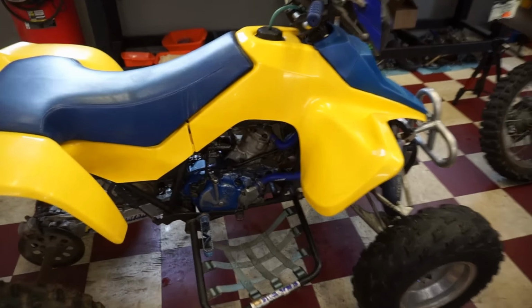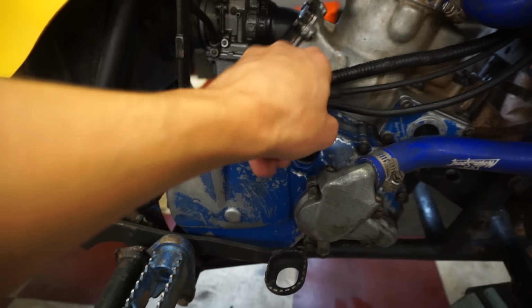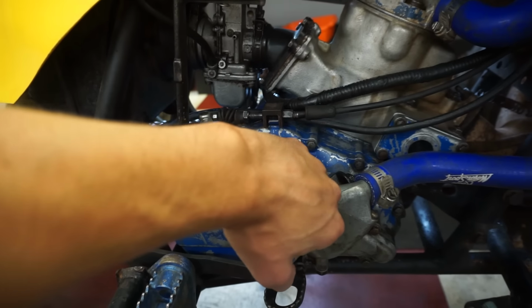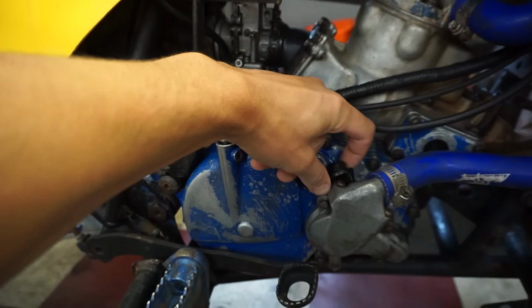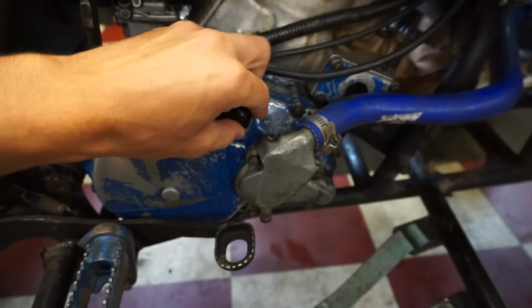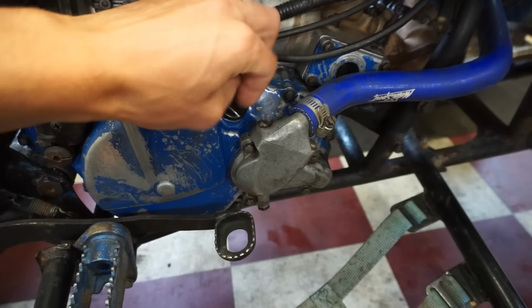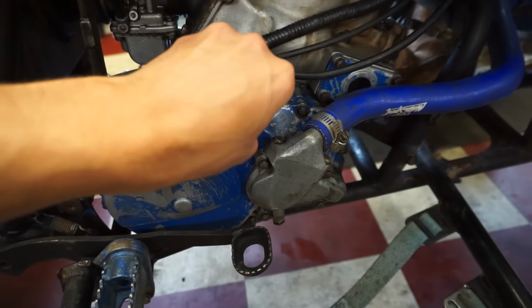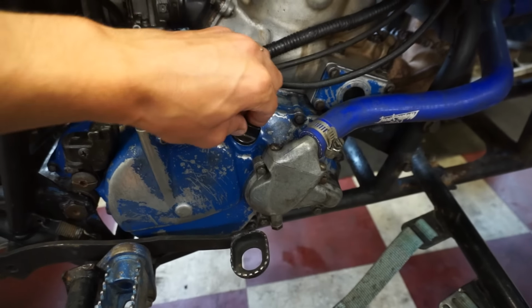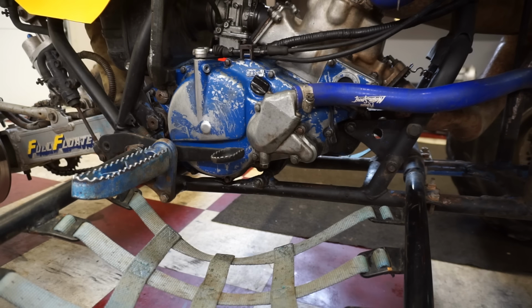All right, let's start by draining the oil. See what that looks like. Last time we checked, it wasn't milky. Yeah, it's brand new oil in there. So we'll drain that out and we'll probably save that if it's good. And we're gonna check for metallic flakes too, see if something's rubbing in there, getting ground down. I looked at the diagrams when rebuilding this thing and everything was perfect. We'll start by draining the coolant and we're gonna save that because it's brand new.